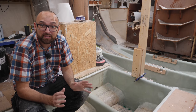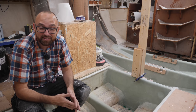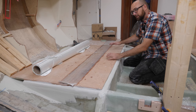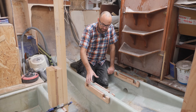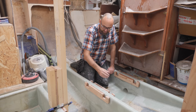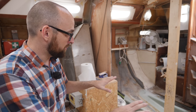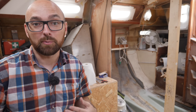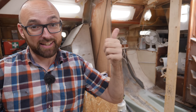And that's basically going to be it for this weekend's video. I'm going to spend the rest of today tidying up aboard the boat and dropping off a ton of stuff at the recycling center. This week I managed to prep this section of hull and get a piece of cabin sole installed. I also took care of the bilge and installed the plywood supports where there's going to be openings in the cabin sole to gain access to the bilge area. I think I've made a decent amount of progress this week. As far as next week, I might attempt to put down the rest of the cabin sole, or I might replace one of the old knees. As always feel free to leave a comment down below, and if you've enjoyed this video remember to leave a like. See you!